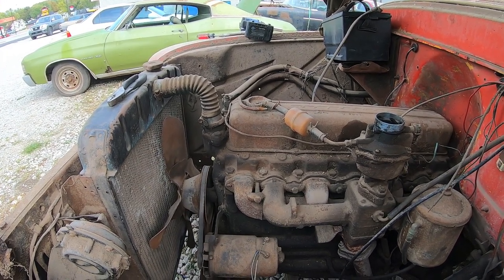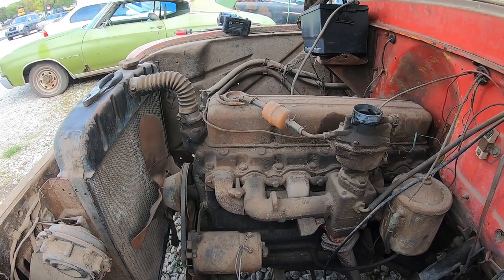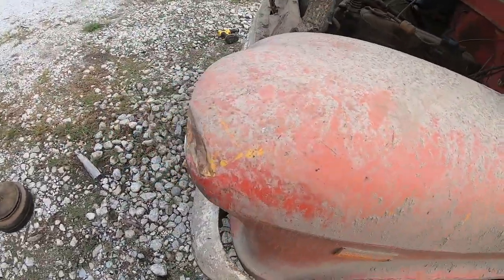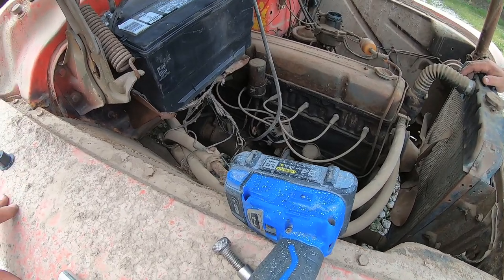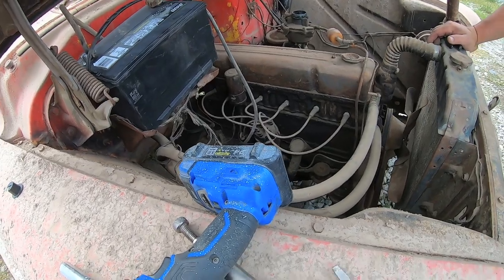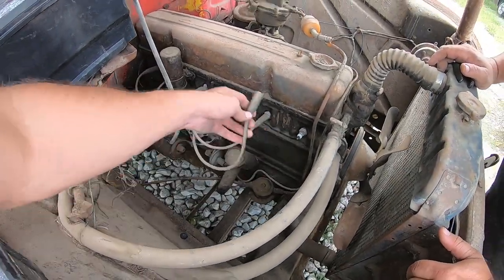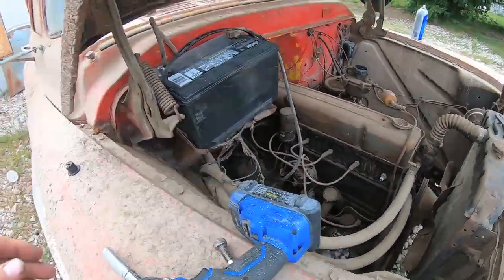You think more? Well, I just don't want to like. No, I'm just saying we might actually have to break in the distributor and do some point cleaning. Yeah, at least some points. I guess let's pull a plug and see what's up. Yeah. The thing is, you can't give any gas while you're spinning because your foot is engaging a starter and trying to slide over your heel and do some pump action. Yeah, do the heel toe. They're definitely new plugs and new wires and stuff, so we won't have to do too much.